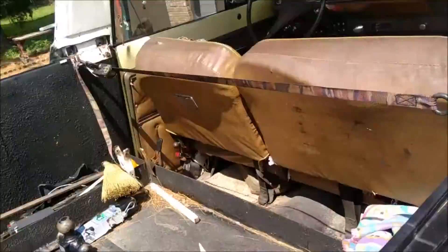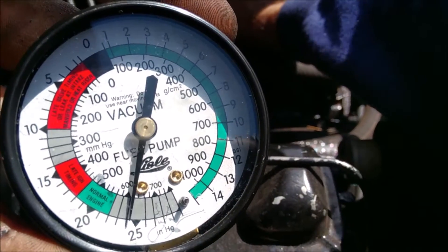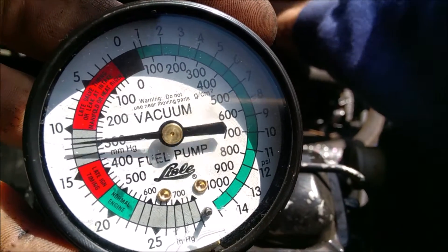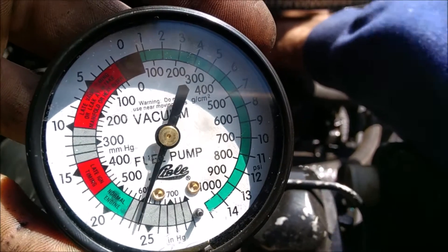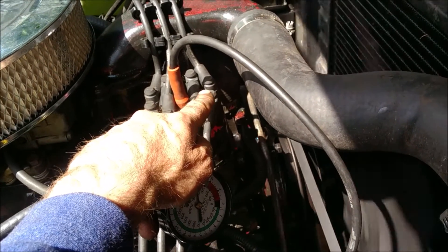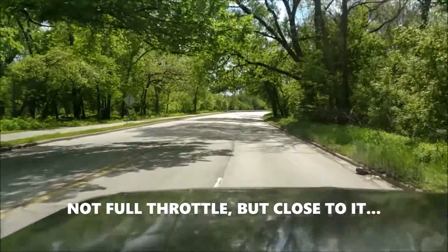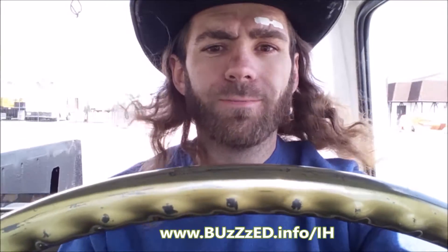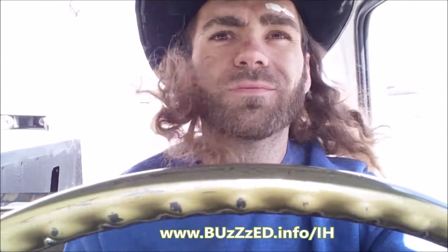One quick thing I'll show you here: watch how I blip the throttle — she'll jump to zero, up to 25, and back down. That's exactly how it's supposed to be. That means the carb is just right and tuned perfectly every time. The front two plug wires there in the cap are parallel to the radiator, which is a good rule of thumb. Let's test her out. You can hear it really whipping well. I'm Eric the Wrench — stay tuned, please subscribe, and enjoy your wheeling.